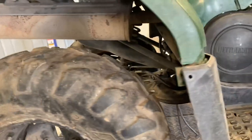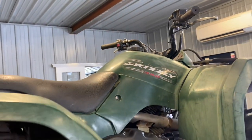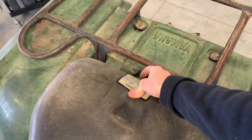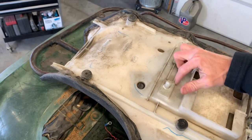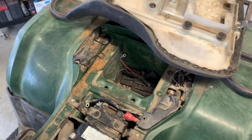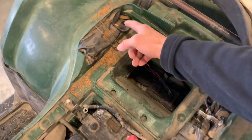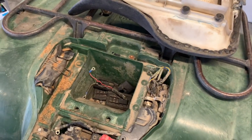Going up to your seat and controls — I want to show you what it looks like underneath that seat and what those handlebars and controls do. On the back of the seat area, you've got a latch. Pull that latch up, then lift your seat — it's got to slide out of a couple places, so kind of pull back and up, then flip your seat over. Typically you've got a manual that sits in here. There are two posts that hold the seat in place, and tabs up front that slide underneath. That's why you kind of have to jerk it up to pull the seat off. Normally there's a tool kit that sits underneath held by a rubber strap — make sure to check that out before you go riding. There's also a storage box here to throw your stuff in.